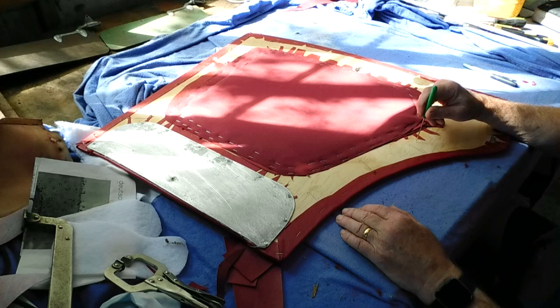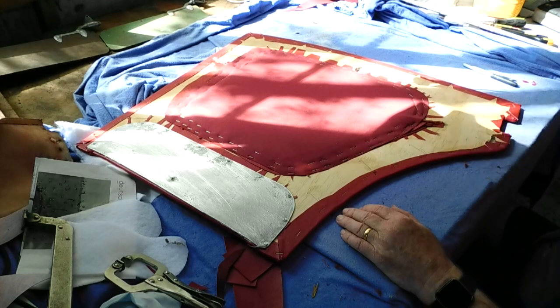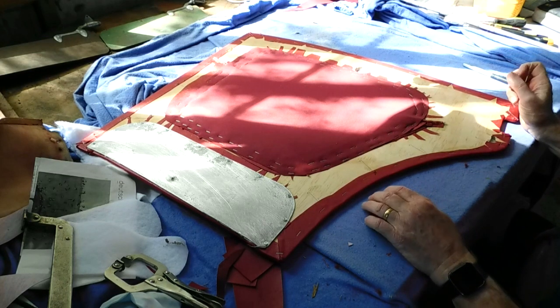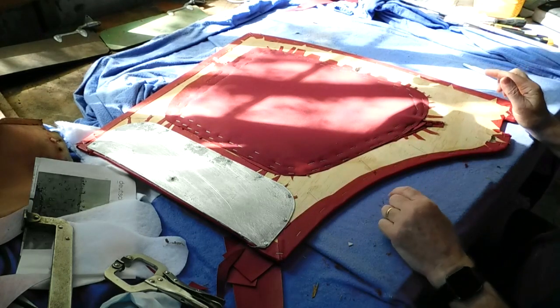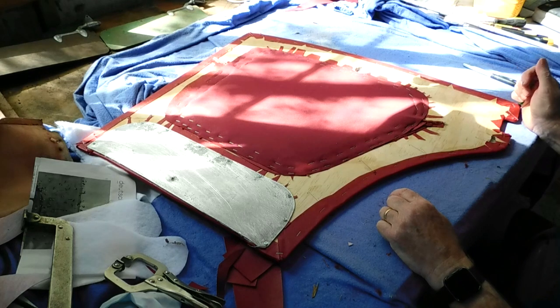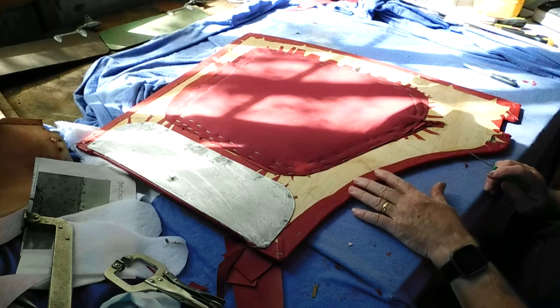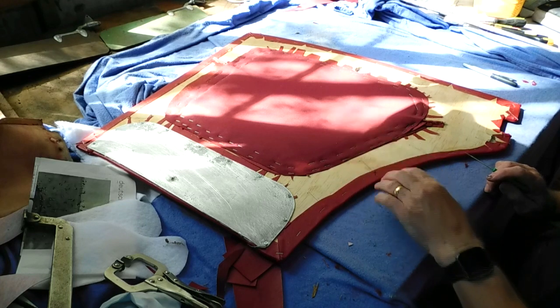Another important thing, you might recall that when I did the door card, I actually mounted the door card to the door. So I drilled the position of the screw holes and so on, and lined everything up. Now, the importance of that is to make sure you've got everything perfectly aligned and it fits the door. But the problem you can encounter is if you forget you've drilled those holes and haven't marked where they are, once you put the vinyl on, for the most part, most of the holes are likely to be covered, as in the case here. I think there was only one that wasn't covered on the other side.